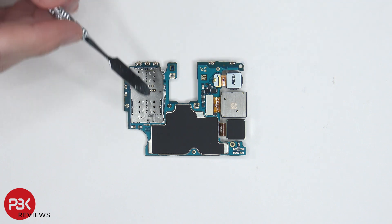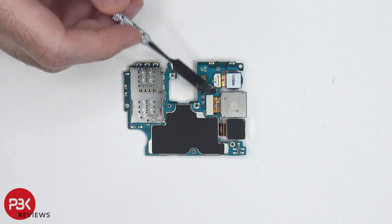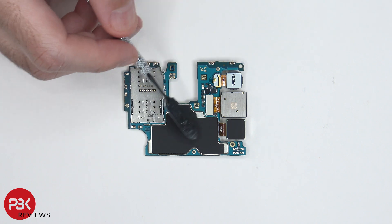Taking a look at the back, you have your SIM card and memory card reader located over here, and the other two connectors for the camera are located over here on the back. The camera connectors can be disconnected by just popping them off. The proximity sensor is located over here on top, and there's a graphite pad over here over the shield.